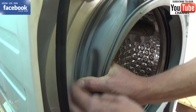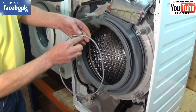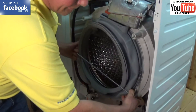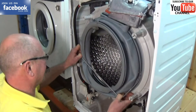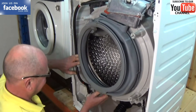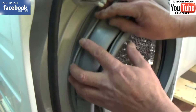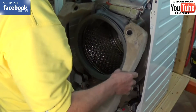Now you can see me putting the seal over — make sure it's round all the way correctly. Once you've done that, we're able to put the spring back on. This is quite hard on your hands. The spring is designed to hold the seal in place on the drum and there's quite a lot of tension on there. It's a good idea to get another member of the household to give you a hand — you can never go wrong with an extra set of hands. I make it look a lot easier than it actually is. Once you've got the door seal on with the band, just double check your marks to make sure it's all lining up correctly and that you haven't got the seal skewed. Then once you're happy with that, we're ready to put the concrete block on.